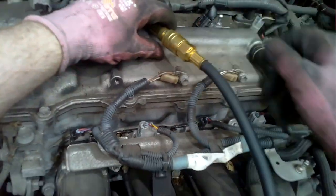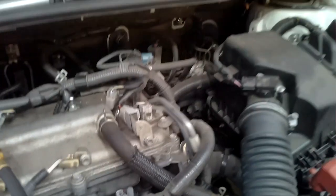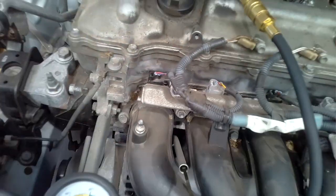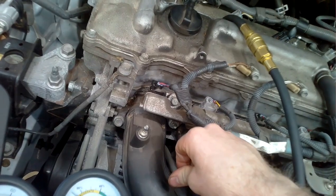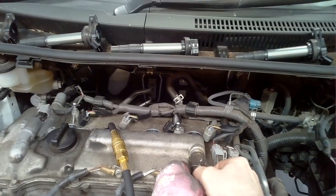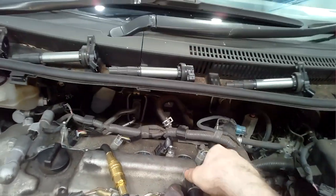I connect up the air and then it's listen. I start off by checking through the dipstick to see if there's anything pushing down through there — what we're evaluating there is the piston rings or the cylinder walls. If there's any damage, even a cracked piston, you're going to have a blow-through causing air to pass out the dipstick. If you don't have a dipstick you can remove the oil filler cap or remove a pipe off the PCV valve, which will also give you an idea if there's air passing into the lower side of the engine.